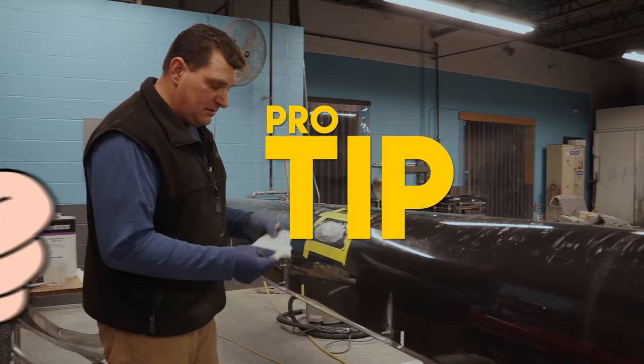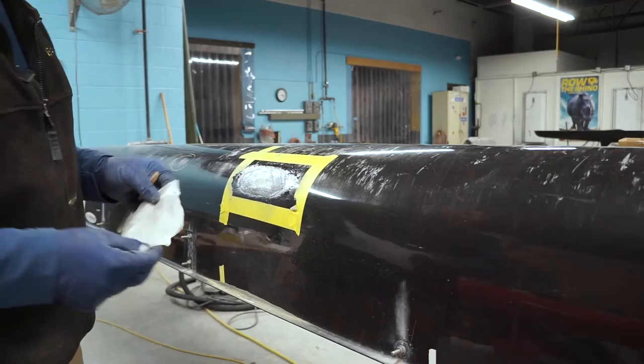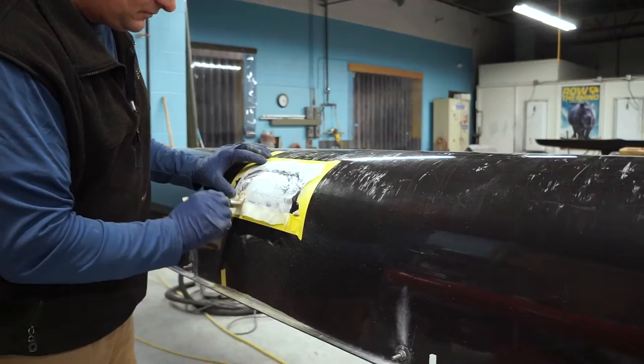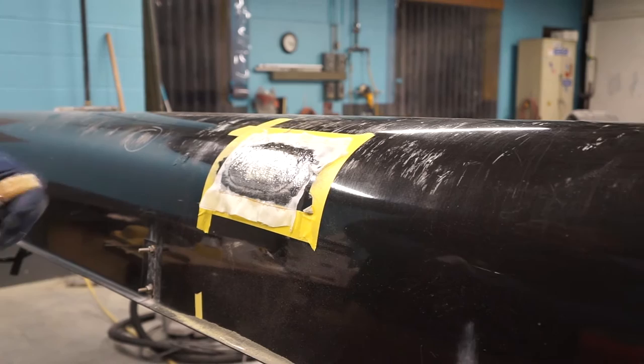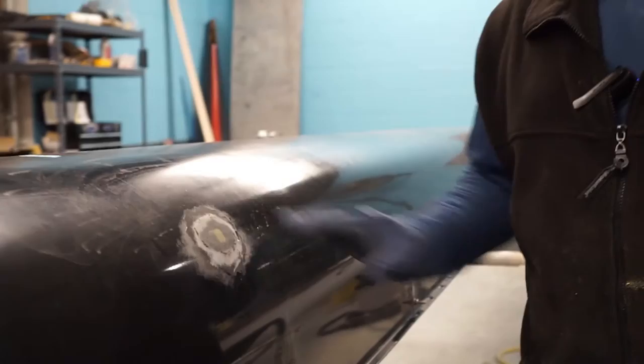Now this would have to cure, depending on time, temperature, and humidity, for about 12 hours. Because we have access to it, we're going to use a layer of resin control fabric to give an even smoother finish to our fiberglass. This isn't a required step, but if you have access to it, why wouldn't you use it? Very similar to the fiberglass itself, we're just going to put it right over the boat and stipple it in with a little bit more resin. This will also eliminate any drips from the resin as it dries. If you ever get a little drip of resin anywhere you don't want it, just take a piece of fiberglass cloth and blot it up — it'll pick it up better than any paper towel.